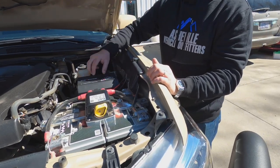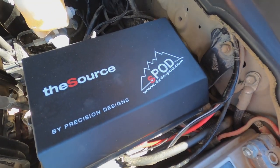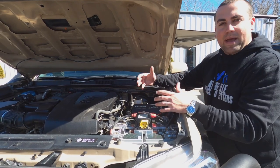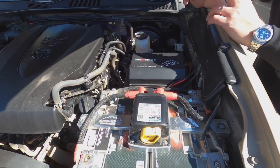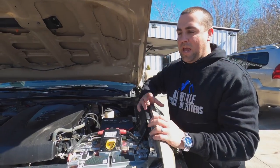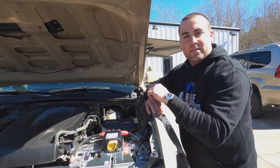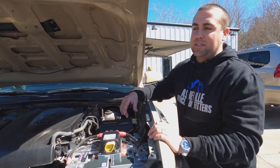Over here we have an s-pod that manages and controls all of our electrical accessories on the vehicle — things like Baja Designs LP9s on the front, ARB compressor, front and rear lockers, and that kind of stuff. It keeps everything clean because there's one connection to the battery and one wire goes inside the vehicle to connect all the switches. This is an older setup for us now — we use the Bantam X from s-pod with a touchscreen. It's even easier: one ethernet cable runs inside to a touchscreen where we can dim lights, strobe lights, rename accessories, and see battery voltage.